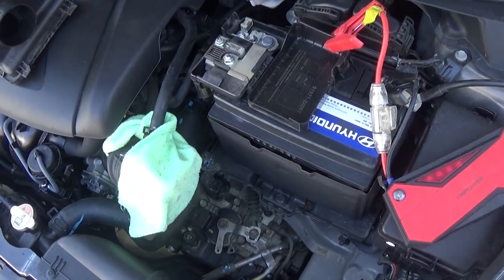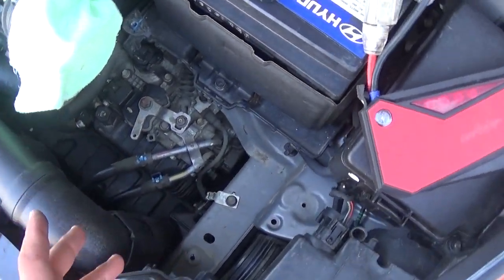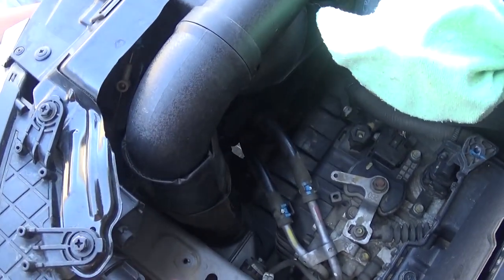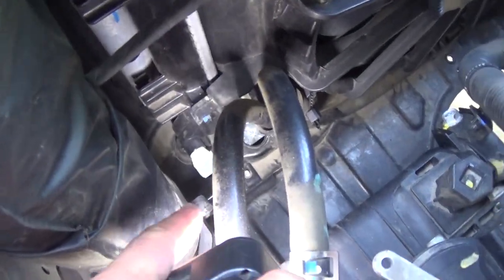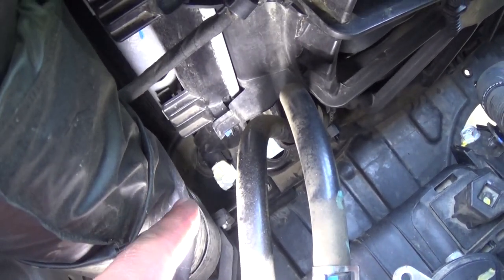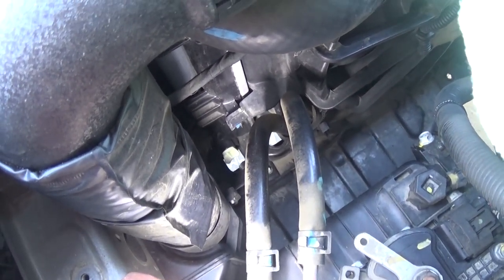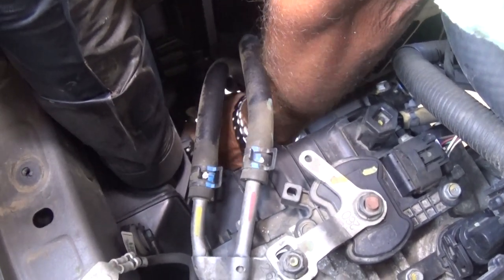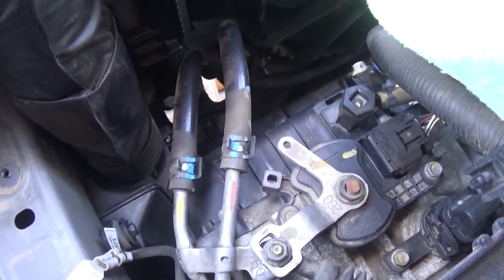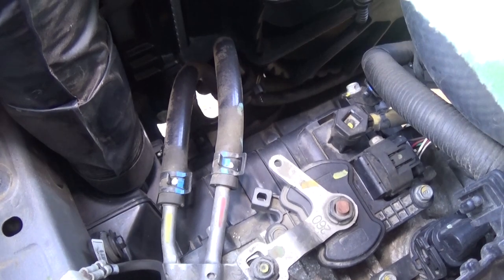You will have to do minimal disassembly — you do not have to remove the air filter box. I removed it so I can position my camera and show you where the drain plug is located. Facing the front left side of the vehicle on the radiator, that white thing down there is the radiator drain plug. We'll get it loose by turning it counterclockwise to drain the coolant.